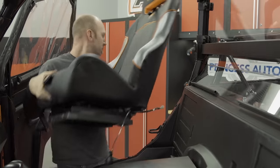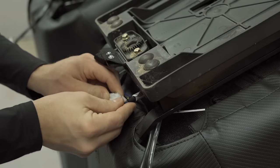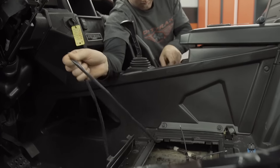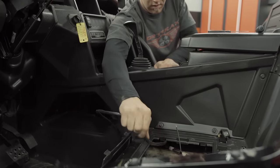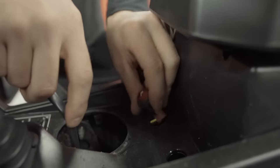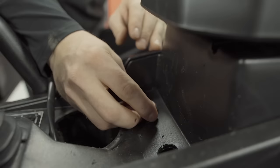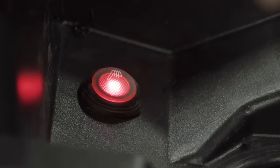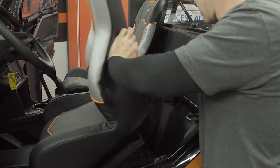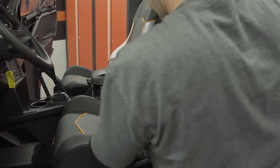If you're using a vehicle in cold weather, heated seats are one of the most welcome accessories I can think of. PRP sends the seats with the heating elements pre-installed and uses nice snap connectors so you can easily remove the seats when needed. The install kit is straightforward — requires some wire routing and a little drilling for the switch, but goes in easy and clean. We also went with the built-in lumbar pump. We find the lumbar option adds huge comfort and reduces back fatigue significantly. With a simple bulb hand pump and release valve, you can increase or decrease lumbar support, even on the fly.